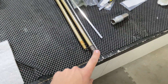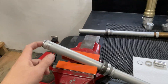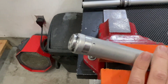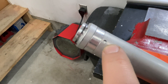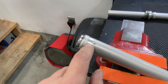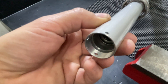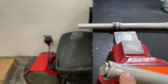The cartridge rod will have your rebound piston and mid valve on it. You're just going to remove the lock nut from the shaft and the entire shaft will slide right out. Now, if your forks are stock you're going to have four peening marks around the outside. You have to drill those out, but you're not going to drill all the way through into the actual seal holding assembly. You only want to drill through that outer layer — about a 16th or 32nd of an inch, or a couple of millimeters.